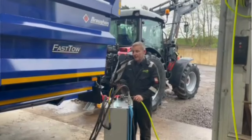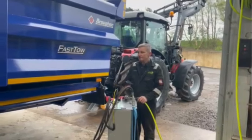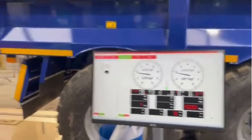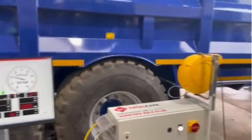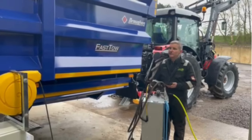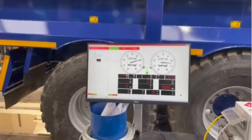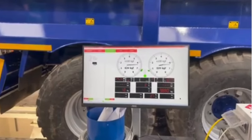Test one is the front axle, or the first axle. Let's fire it up. So that's the first axle turning. The first thing we're going to do is check for ovality of the drums, so we can put a little bit of brake pressure on. We can see straight away on the overhead screen that the three lights have come on for each wheel, which means the drums are round.